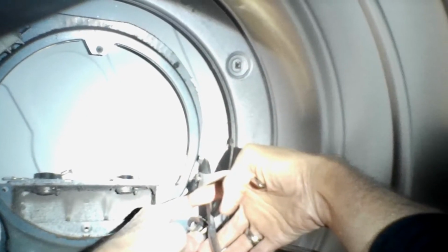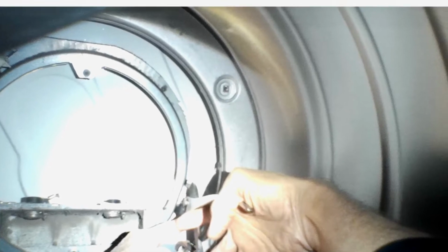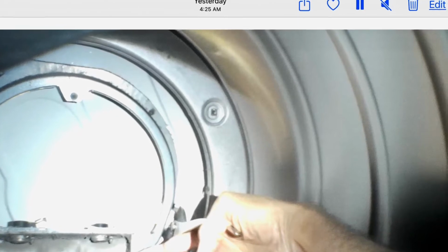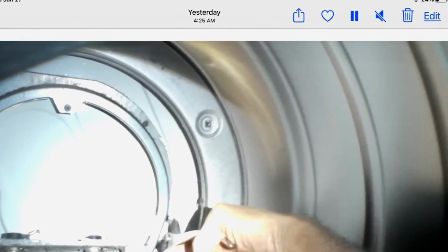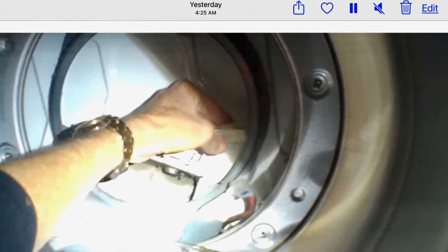We're going to grab a pair of pliers and pull that connector out to your right to make it release. And then the female side of that it was plugged into has to be removed too. And you do that by using a pair of pliers to pinch in on the sides, and you push it in to your left toward the middle of the dryer. And that's going to make it disconnect. And now you can actually pull the old element out of the dryer. So we just pulled that plug free of where it was.